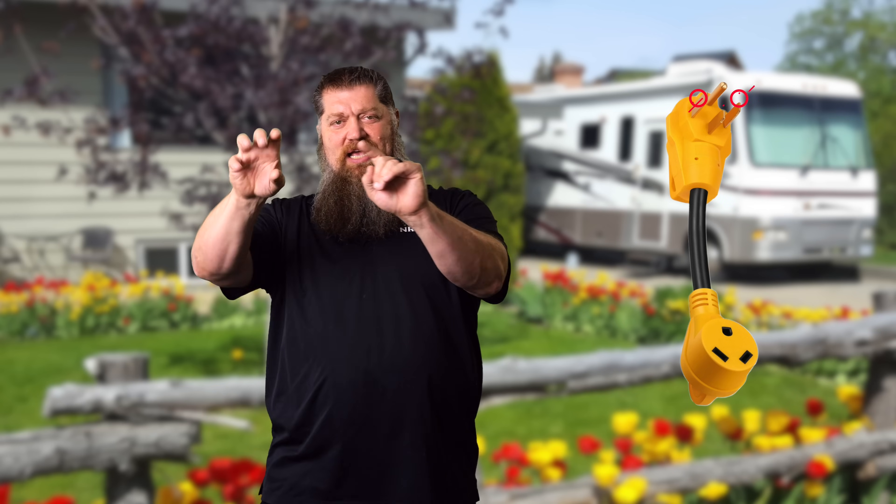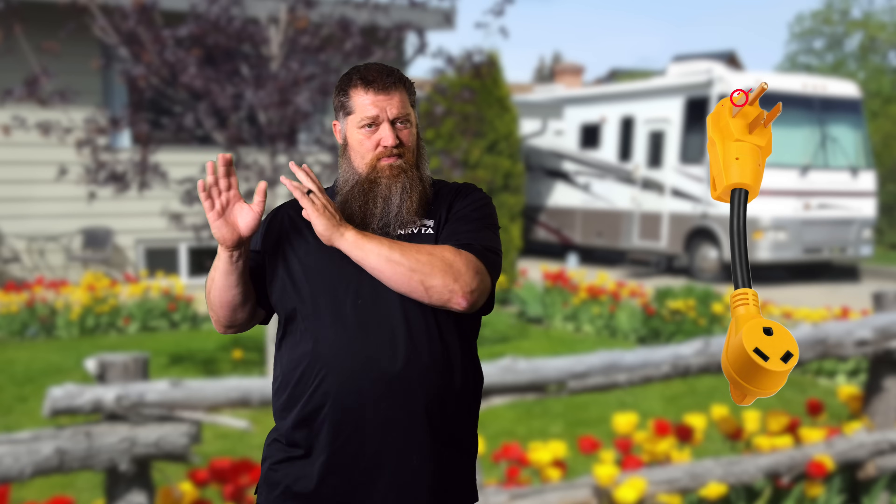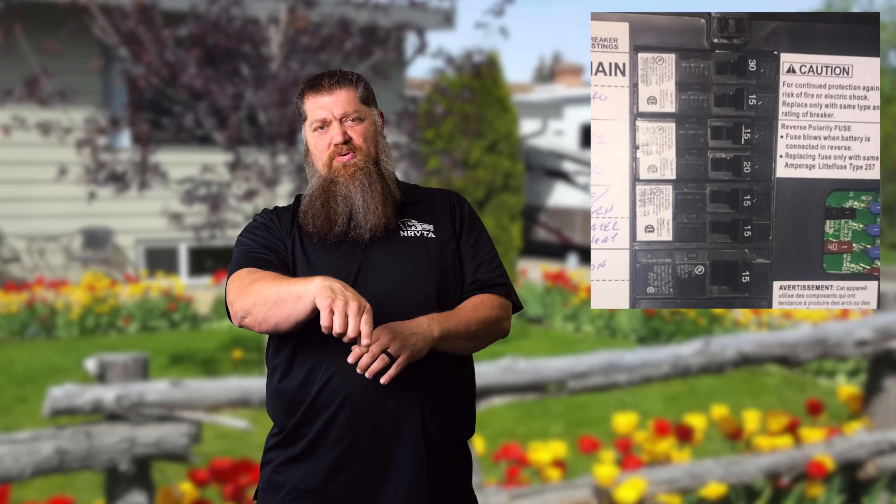Here's the thing: you're only going to get one of those two legs. We abandon one of those legs inside the housing, so you only get one leg coming in. Now if I have a potential of 50 amps but my RV is only 30 amps, do I worry about blowing things up? The answer is no, because inside the RV you get your panel breaker box, and in there there's a 30 amp breaker.